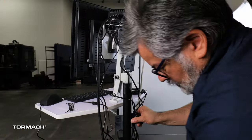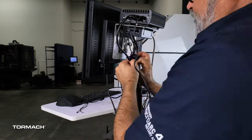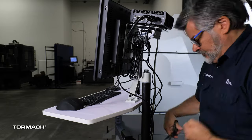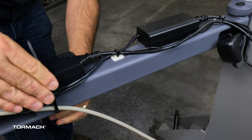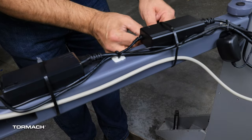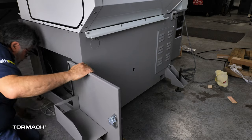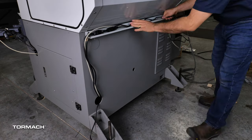To manage cables underneath the controller, wrap them as neatly as possible into two bundles. Then wire tie them to the monitor arm supports. Strap the wires down to the monitor post and turn the keyboard tray to check for any binding. Cut off the excess wire ties. To give the AC adapters extra support, use several large wire ties to strap them down to the arm while also securing the DB25 cable. Run the extension cables and the DB25 cable through the side pass-through and then out the back. Place each cable onto the rear wire trough towards the electrical inputs.